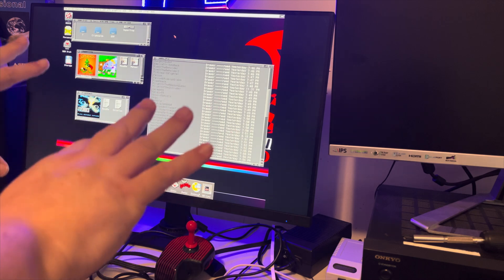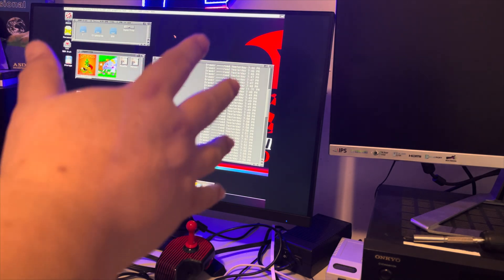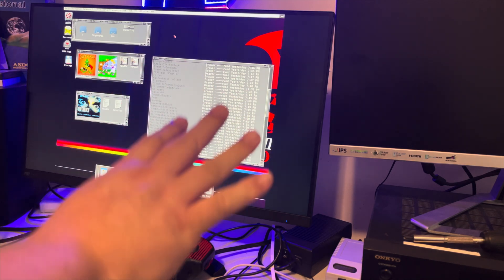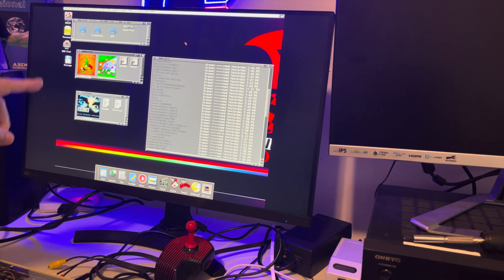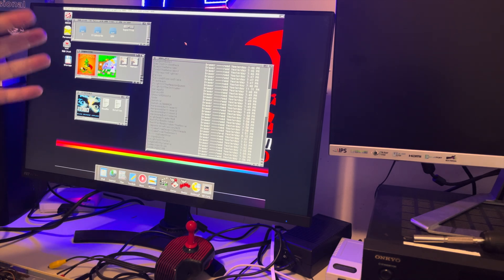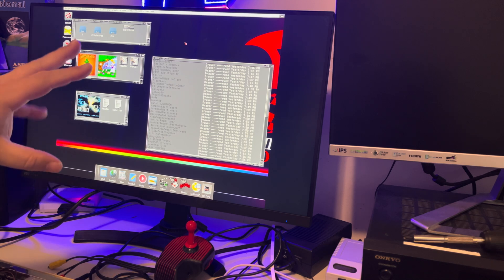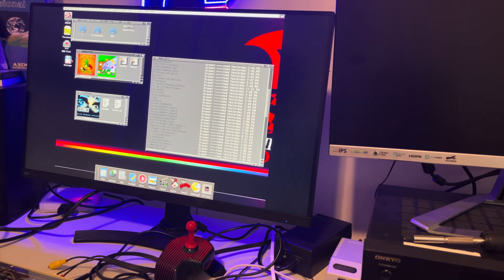Things have changed here. I'm using a real monitor now instead of that little dinky thing — that was introducing way too many weird things. We're running in a 4:3 aspect because I have the SAGA driver — the RTG version of Apollo — set to 1024x768. I did finally figure out I am running core 9463, which is the release core, and yes, that core does include flicker fixer ability. It's very early flicker fixer ability — kind of weird how it's working. I'm going to try and show you this, along with the issue I'm having with my DH1 partition.